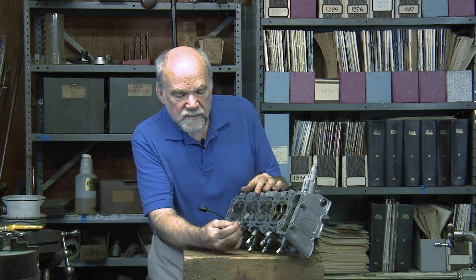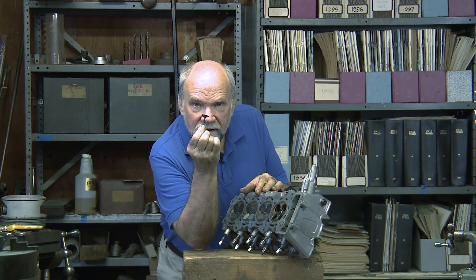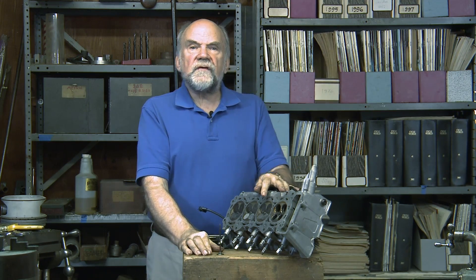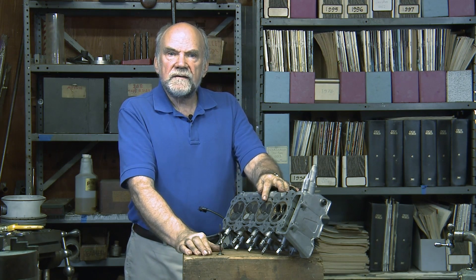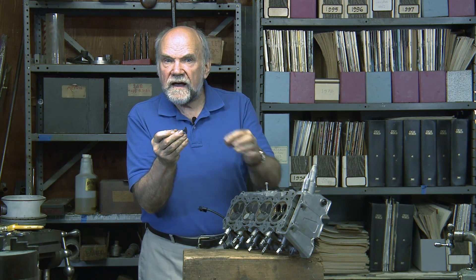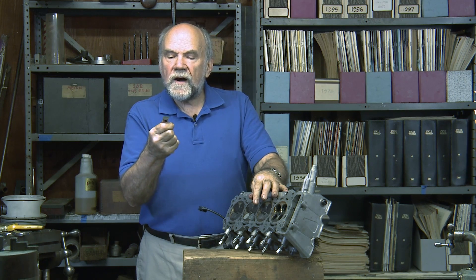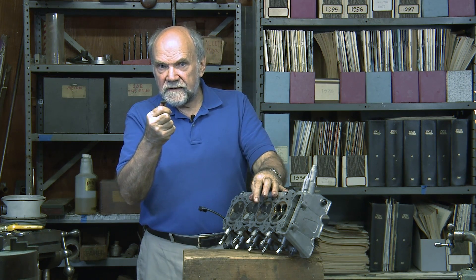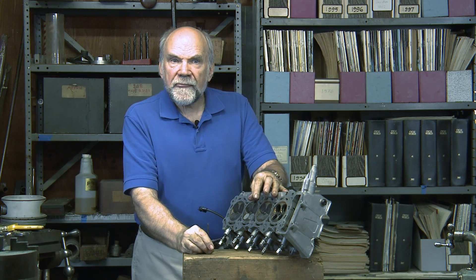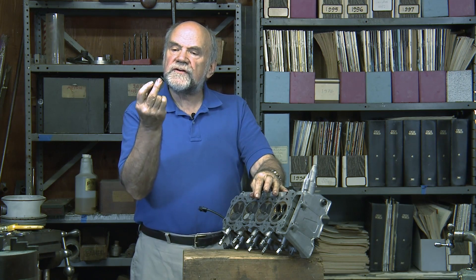So we're really fortunate in sport bike engines that their exhaust valves are such cute little guys, because their short heat path means that their survival is pretty well guaranteed. In bigger engines, sometimes you'll see chunks taken out of the head of the exhaust valve. What's happened is a crumb of carbon has held the valve open slightly. Leakage of combustion gas past the valve heats it way up and a flame channel develops — looks like somebody had gone after the poor valve with a torch.